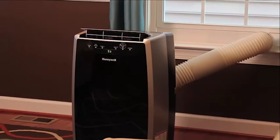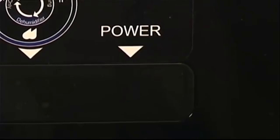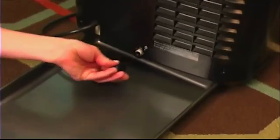After using your air conditioner in this mode, especially in a humid environment, water may collect in a tank inside. When the tank becomes full, the power button will flash and the unit will not operate. To drain the condensation tank in cooling mode, unplug the unit and place a shallow pan, such as a baking pan, under the lower drain plug.